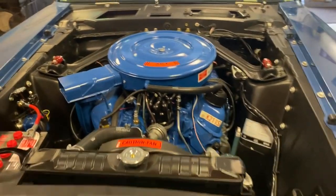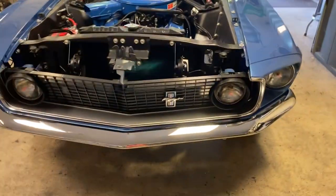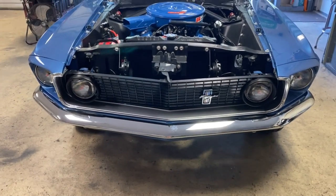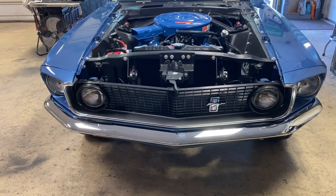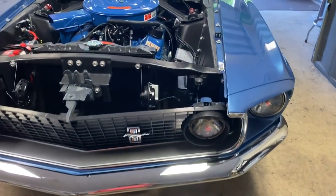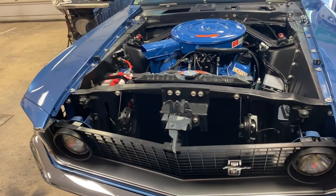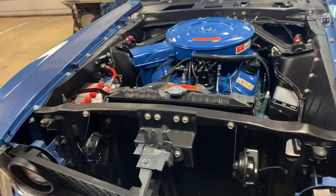I guessed wrong. After I got the headlights installed, see, for headlights, the two center high beams, the one on the outside is a combination high-low. I wanted to see the high beams. And when I turned the high beam switch on, which is a foot switch in this era car, the windshield washer turned on. Likewise, when I pressed the windshield washer, the high beams came on.